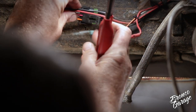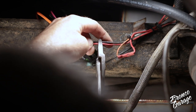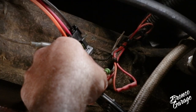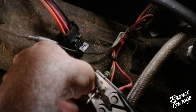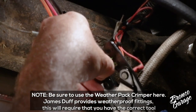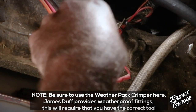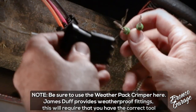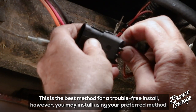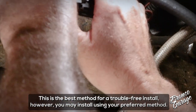It is time to cut and splice the wiring on your Bronco to the tank wiring. For this install, we have a ground and a sending unit wire. The wire harness is also plumbed for an EFI pump for that eventual upgrade. Be sure to tuck the wiring and plumbing up high and out of the way of any heat source or moving parts. If your plumbing or external pump is within six inches of your muffler, you may want to wrap or heat shield your pump and hose to prevent fuel boiling or vapor lock issues. You can also wrap the muffler with heat shield. James Duff provides both the male and female weatherpack connector, but you will need to source the correct crimping tool.